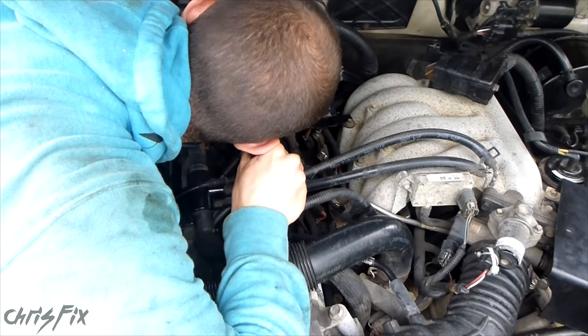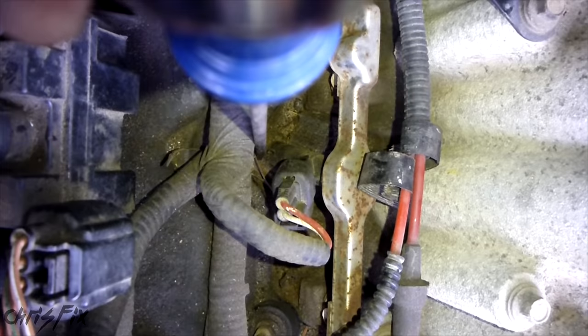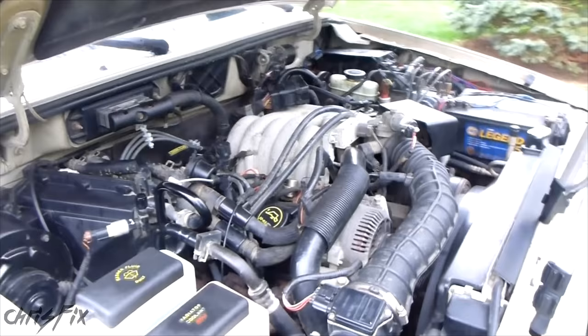Here's what it should sound like. You can hear that clicking and it's consistent. That means that the injector is firing and it's firing consistently, and you'll check each injector.